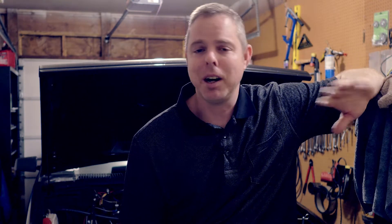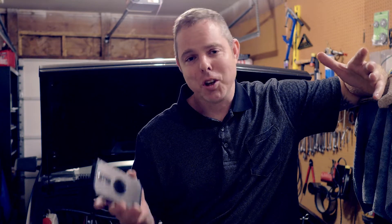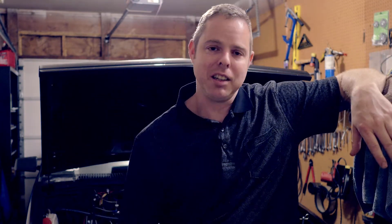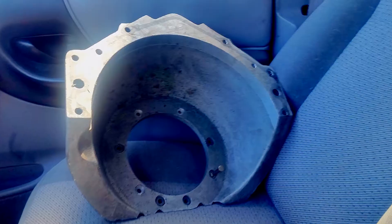It's been a debacle to put that 8-inch in. When I pulled the transmission back and lowered it down to get the torque converter out, I looked up into the bell housing and of course there was a crack in it. A TH350 transmission does not have a removable bell housing, but there is a fix.